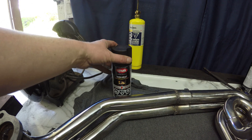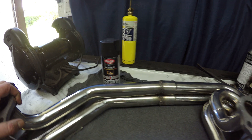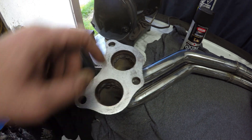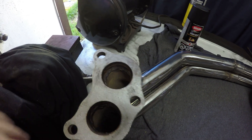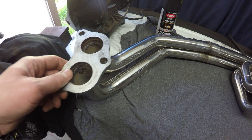I've got this high-heat resistant paint — it's basically just barbecue paint, I did get it at Napa. I think a few coats of that and I'm even gonna spray some on the inside where the welds came through. I did take my carbide and go around in there but I see some more beads to clean up before I paint. Because it's such a beautiful day outside I'm gonna bring the pipe out and spray it outside, let it sit in the sun — the sun hitting that black paint should make it set really quickly.